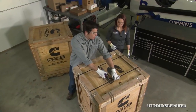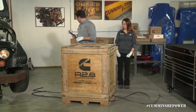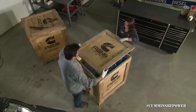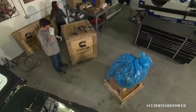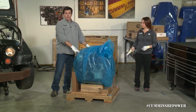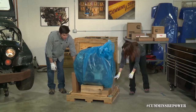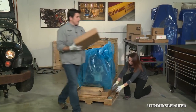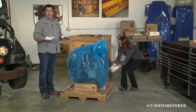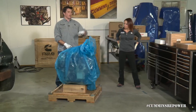These bands are under tension, so you never want anyone standing beside you when you snap them. Now you can see this nice blue bag — this is a moisture-wicking bag. It helps protect your engine during storage, so if you're not quite ready to install it when you get it, you'll be okay for a little while. Packed around the base of the engine you'll see various boxes. Get them all laid out and accounted for — we'll go over and make sure you have everything you're supposed to have. One, two, three, four, five boxes — we'll get into those in a minute.